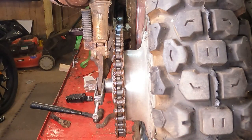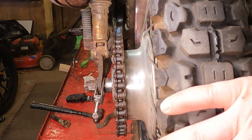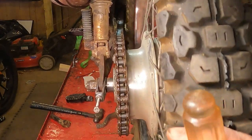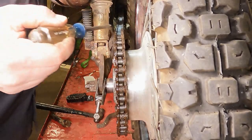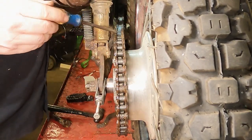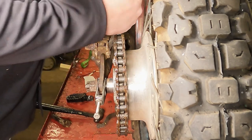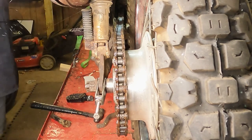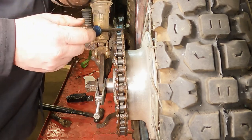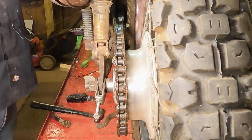Where the wheel sits right now, the chain is fairly well aligned. When your chain is extremely misaligned, it's going to look something like that. If you put your eye to it back here and look up the chain, you should be able to see it pivots — there's a curve right around here — then it gets straight and goes all the way up to the front sprocket. You can't really see the front sprocket and that's okay. If you can straighten out this angle right here, that means the front one will straighten out too because they're going to move at the same angle.